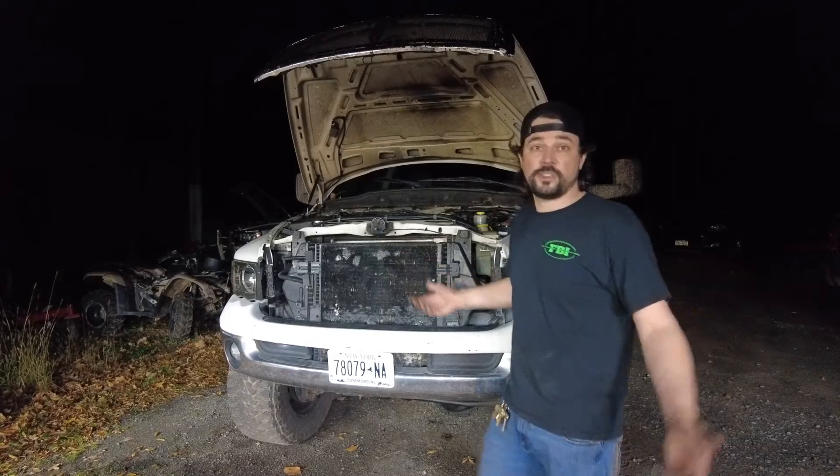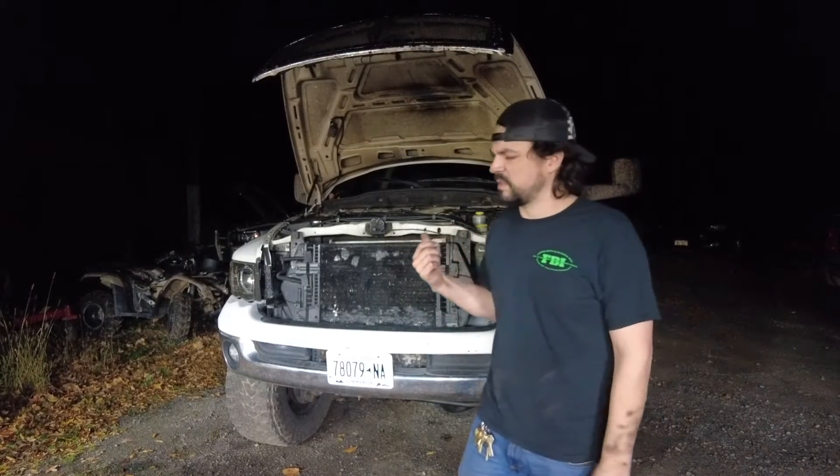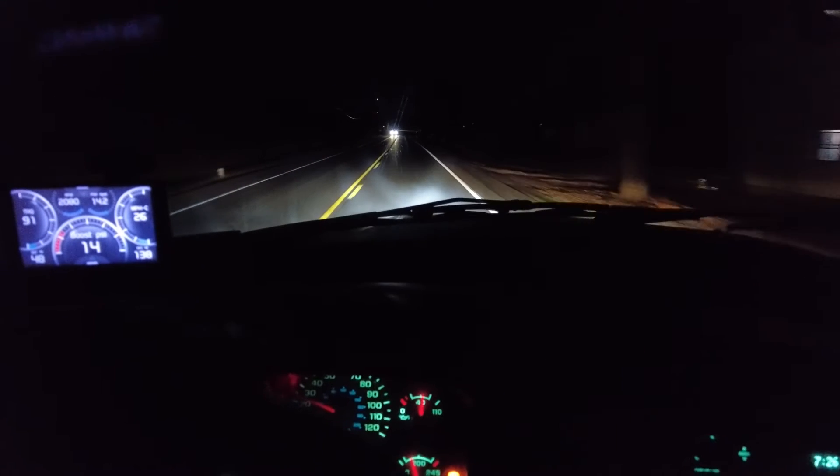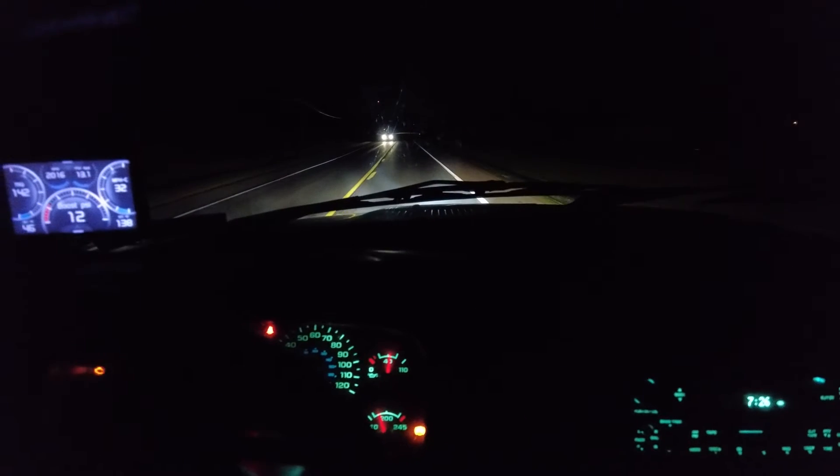Here it is all back together, just got to put those two push pins in. Fan clutch has been changed — let's see if this thing shifts now. Fan clutch shifts. Still got the check engine light; that will probably need to be erased or it will clear on its own over time, but the truck is shifting just fine.